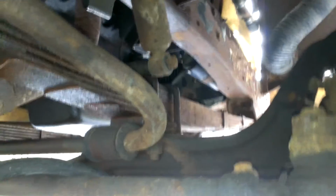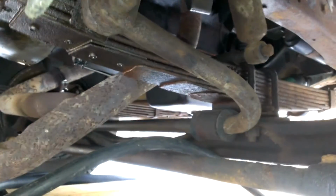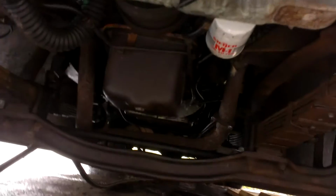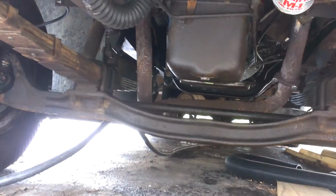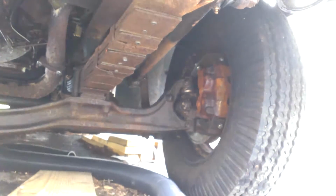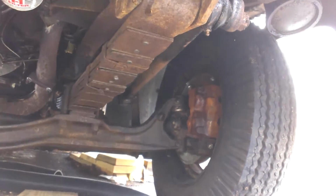Here's the propane tank. Needs new valve. When I got it, the transmission or the valve pan covers were leaking. I put new valve pan covers on it, and new transmission gasket, filter, and fluid, but there's still remnants of where the oil had leaked from the valve pan gaskets. New calipers, which are already starting to rust up.